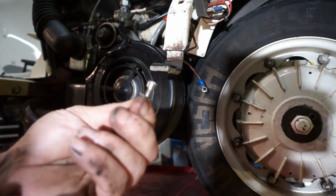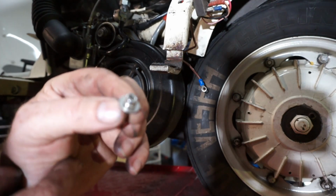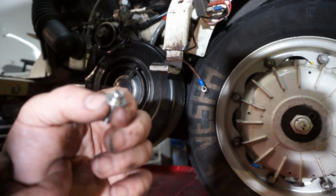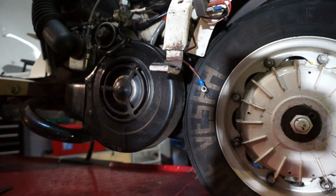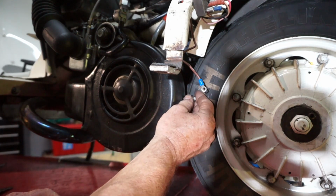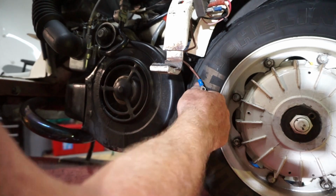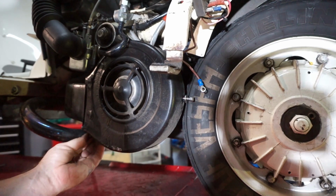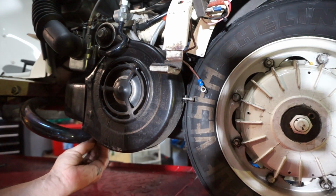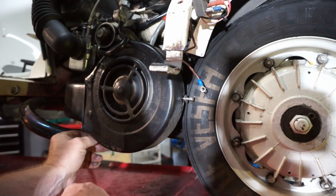Okay, what I'm going to use is some 5 mil Allen bolts with a penny washer on, but they're not oversized ones, they're just small ones. They do nicely spread the load across the cowling and help to stop it from coming loose. So that's one. Two.